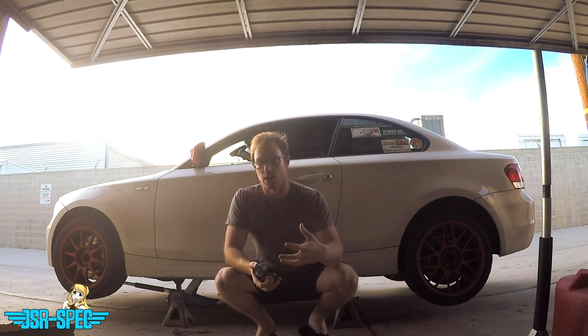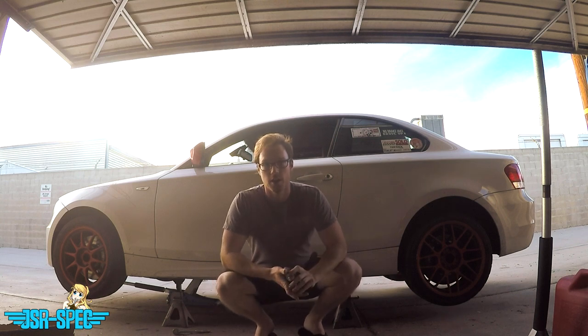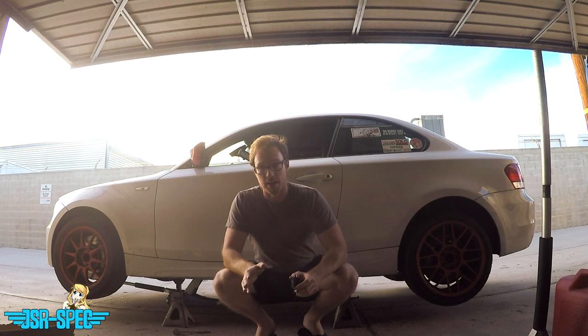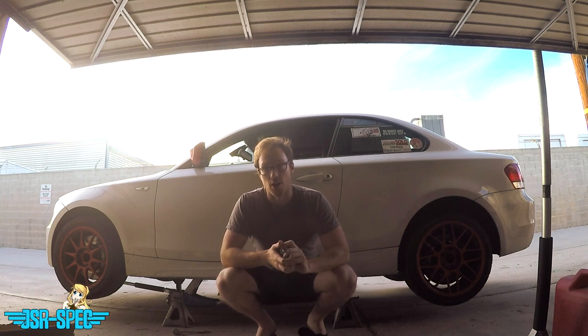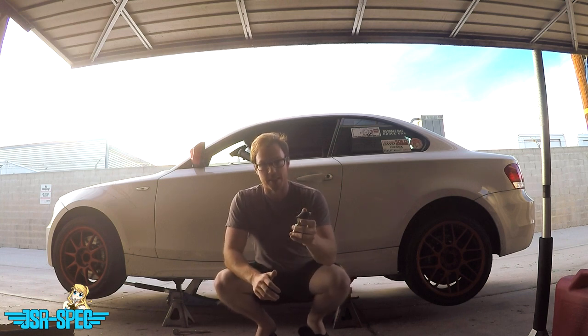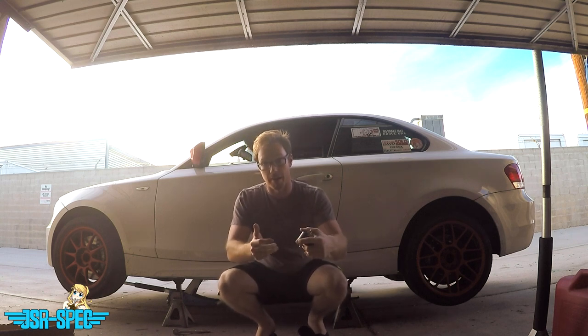They made it really soft, they made it really comfortable. So that means there's very little in the way of NVH, noise, vibration, harshness. So you don't feel a lot of feedback through the shift, you don't feel a lot of shakes or vibrations or anything like that. And that's really nice for daily driving, but the problem is when you're really thrashing the car hard, you get a lot of transmission movement, basically because the mounts are so soft, they can allow the transmission to wiggle side to side and front to back.